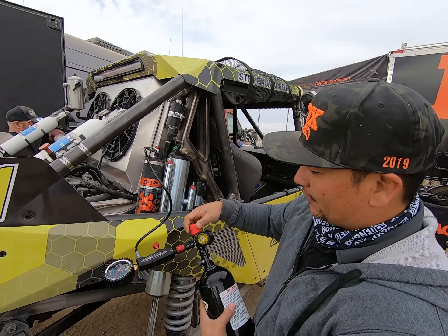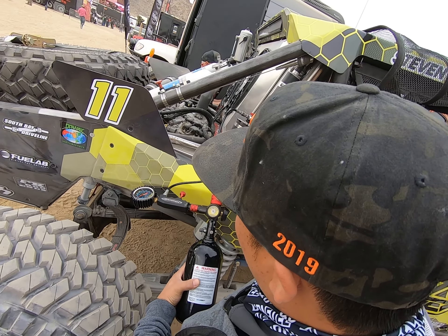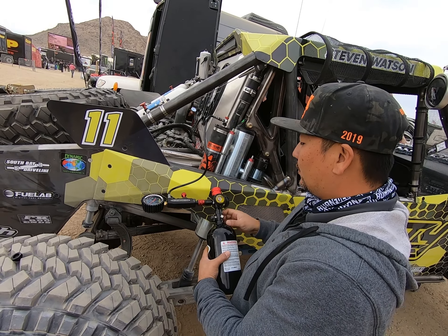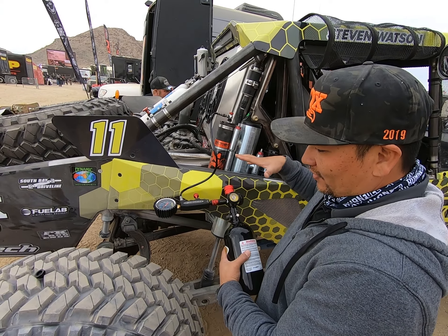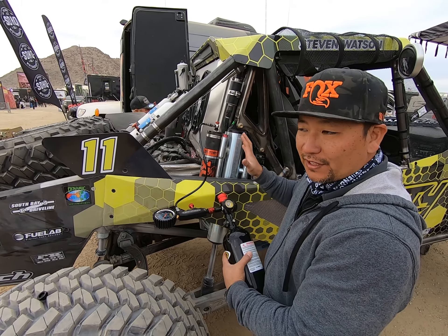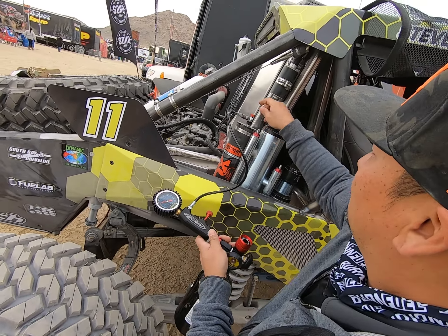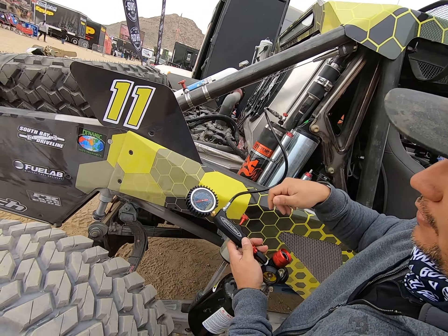From there you set your regulator pressure. This vehicle is on the ground, so typically we'd have everything fully extended and go with 200 psi for all of our shocks — that's a good baseline. Because it's sitting on the ground we compensate for it; I know this shock is going to want about 230 psi at ride height, so I'm matching 230 here. The shock already had 150 pounds, so we're bumping it up. You have a valve so you can go up incrementally, giving it a little more until it hits the exact pressure you're looking for, then shut it off right there.